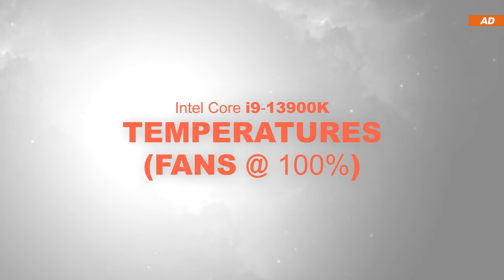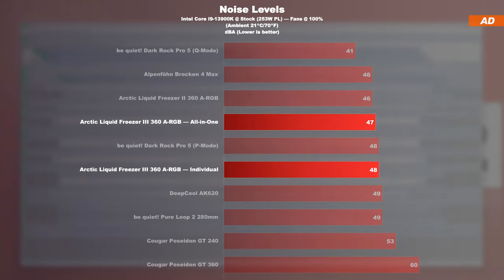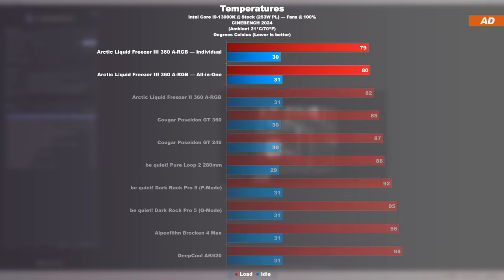Temperatures at max fan speed with the Intel 13900K. In the Prime 95 stress test, the Liquid Freezer 2 and 3 go neck and neck, but position themselves quite above the other cooling solutions out there. Both Liquid Freezer models controlled using the all-in-one connection deliver exactly the same performance in this test run. Only once the speeds are set individually to their max are we able to squeeze out the last drop of additional performance, though this also comes at a cost of slightly higher noise levels. If we then repeat the test in Cinebench 2024, where we are dealing with a heavy AVX load, competing CPU coolers are now catching up. However, it is also clear that the Liquid Freezer 3 shows its strengths the higher the temperatures rise — already 2 to 3 degrees Celsius more powerful than the already impressive Liquid Freezer 2.